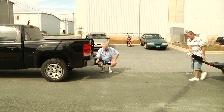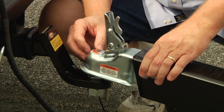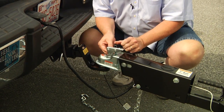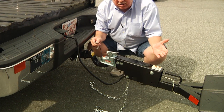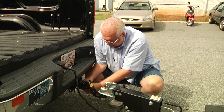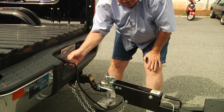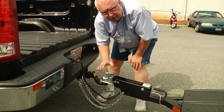It's very important that you start with a two-inch ball. Ideally, you want to be around 14 inches from the ground to the ball. When hooking up your tow dolly, look through the small window at the top of the coupler — this confirms visually that your coupler and ball are fully seated. Then close your locking mechanism, put in your locking pin, and go to your emergency breakaway cable. The cable is designed to fully activate your disc brakes if the coupler comes off the ball. Hook it through the hitch, connect it back to itself, then hook up your safety chains and your four-flat wire. Your tow dolly comes prewired with a four-flat wire for lights only — a brake controller inside your vehicle is not necessary.